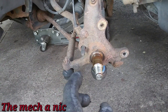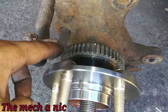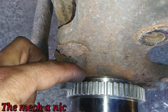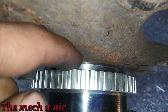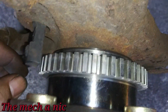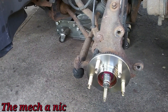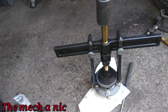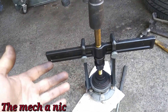We've hit a wall. Looking at the pickup ring for the ABS speed sensor — it's not fully making contact. It's supposed to sit at the very edge, like on the original bearing, but on this new one it's pushed in about a quarter inch. It's not completely lined up with the sensor. That might be a problem. Just my luck — right when you think it's going to be easy, you always run into a problem.